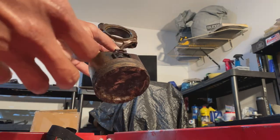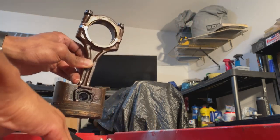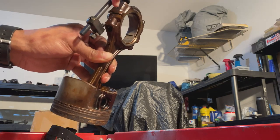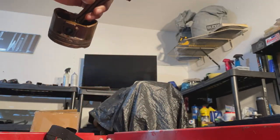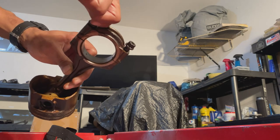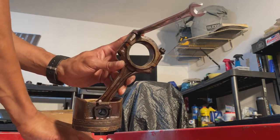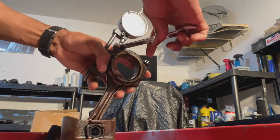So obviously, if the bore's upright, put the piston down in there, flip the bore over, put the cap on. And this one's a little bit more strenuous, I guess, but you put the gauge on. This is just an example. Well, the bad thing about this is first you gotta get your wrench on. Tighten this down, hopefully you guys can see this angle. First you actually have to get your wrench on, which, like I say, will be in the bore, so you won't have to hold it or anything. Then you put the angle gauge on, like so.